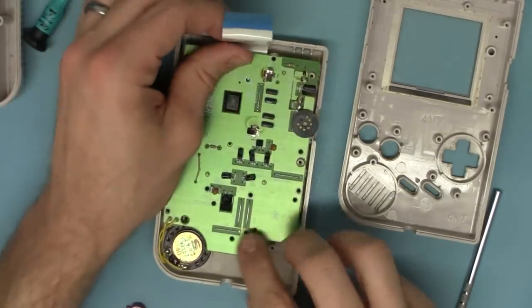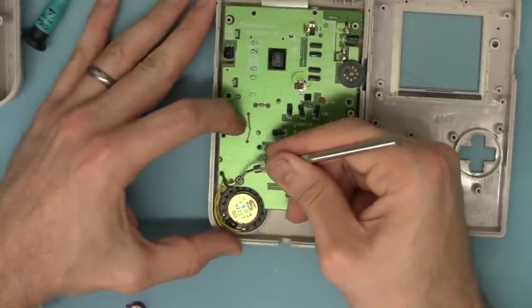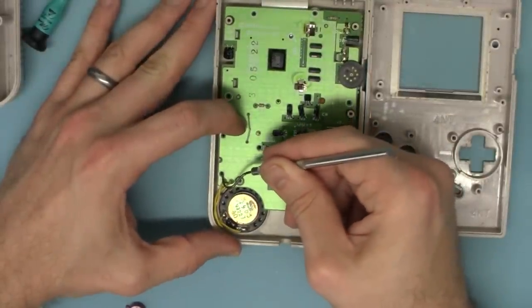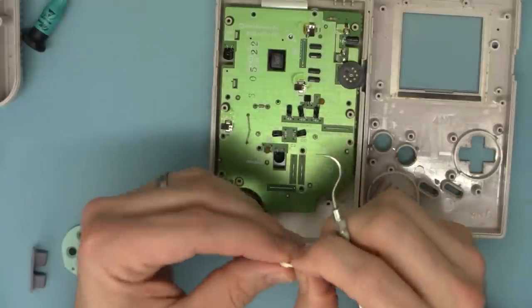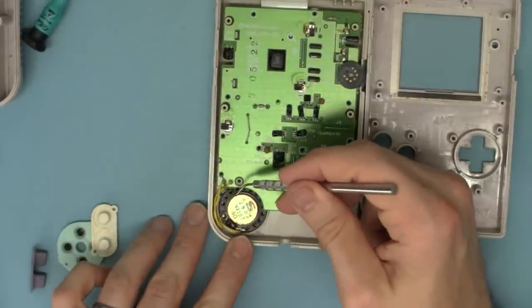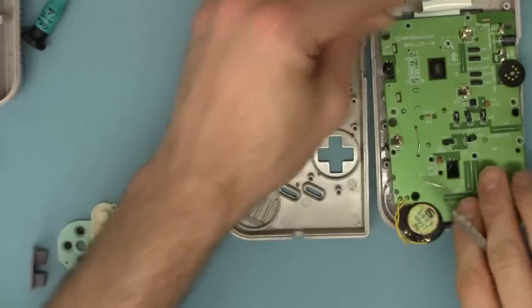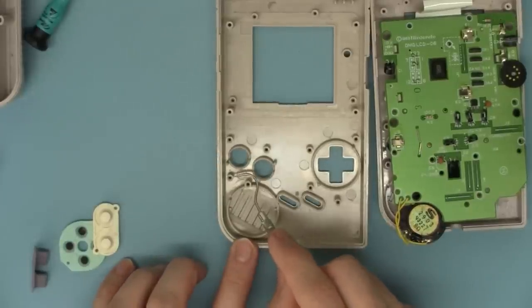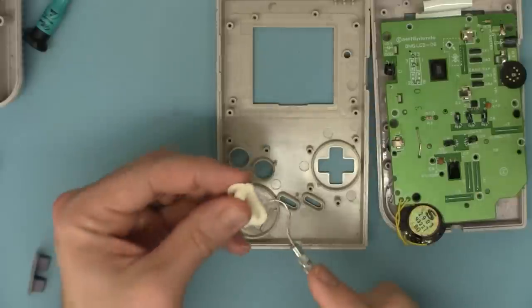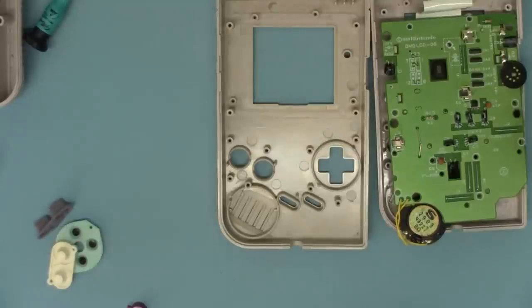When I move it over to the new one, and I look down through the hole at kind of a 45 degree angle, there's almost no space, and there's no way that the edge of the silicone is going to fit without compressing almost maximally. And that's probably the problem: they made these two or three screw posts too high. This one and maybe this one should be a whole lot shorter, at least the part of the width that the silicone takes up. So I think it's time for Mr. Dremel.